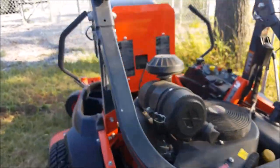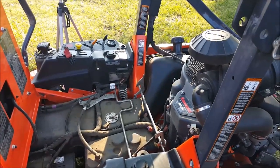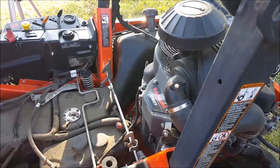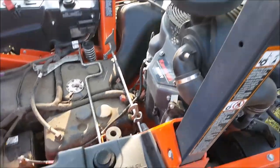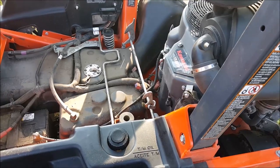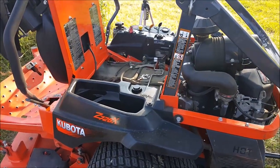So again, you do want to make sure that you have all the air out of the system. So, you know, just in case the fluid level did drop, it may indicate there still is air in the system. Don't be shy. To repurge, again, you would crack the breather ports, add fluid to the expansion tank just until fluid comes out, close the breathing ports, fill your overflow tank to the max line, and do the purge process over again. With air in the system, it will definitely reduce performance, so we don't want that. You don't want air in your system. All you want is nice fresh hydraulic oil.